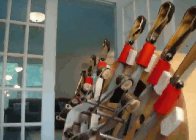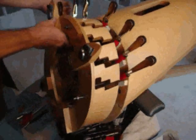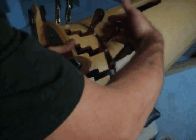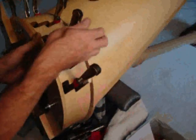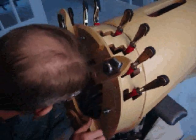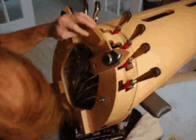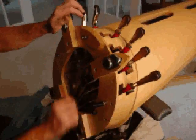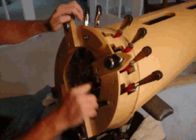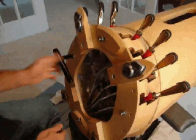All that's left is to put the base back on the same way you took it off. It's a little challenging to line up the pedals sometimes. I put one in D in natural to help me hold it while I line up the other pedals. Then just line up all of the base bolts and screw those back in with the tuning key. They don't have to be incredibly tight, just nice and firm — you don't want to hear wood crunching or anything drastic like that.